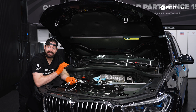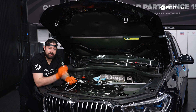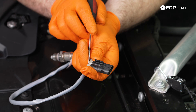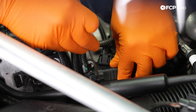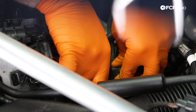It's quite hard to see, so I have our new oxygen sensor here. We're going to have to get a 90-degree pick on the back side and push this over to be able to release this and pull the connector off of its mounting place. With a 90-degree pick, we can come and release this connector lock, and then pull out to get this connector free.